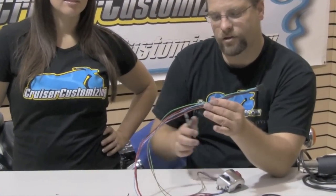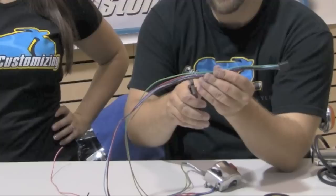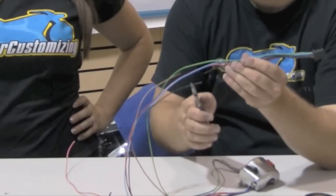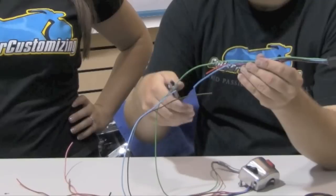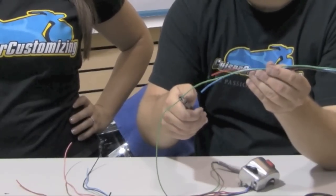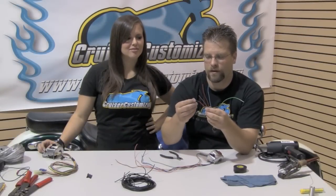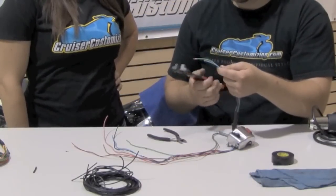When cutting the harness, I'm going to start with the first wire and cut it, then move a half inch to an inch farther up the chain for the next wire. That way all of my connections are in a different location, minimizing the potential for them to short and reducing the mass to pull through the bar. Now that each wire is cut, we're going to slide heat shrink tubing onto each wire, strip the ends, and set up the extension next to the stock harness.